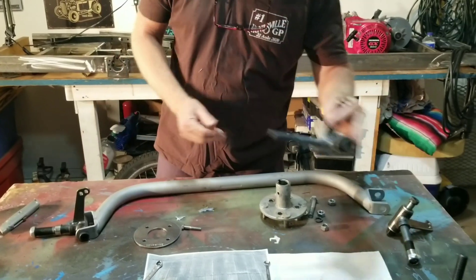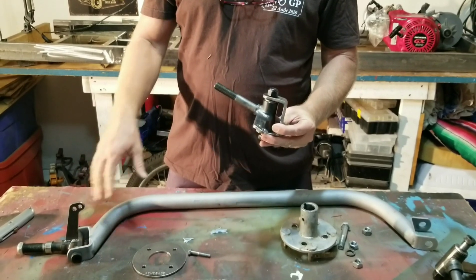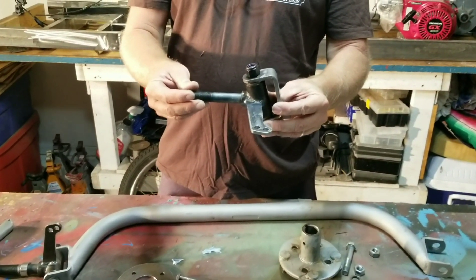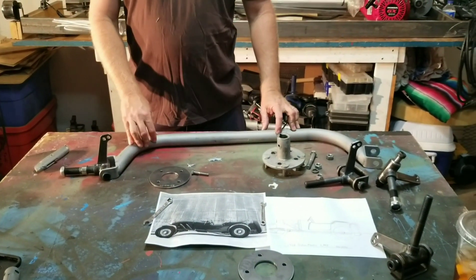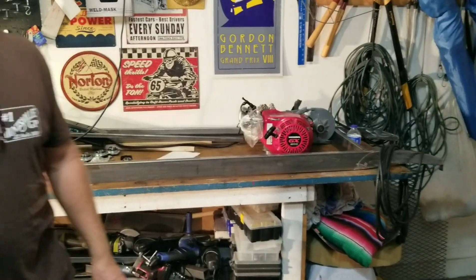That's it for the unboxing video. Hope that was educational and helpful. If you want a cycle cart that handles well and is engineered right, this axle is a good investment - or at very least the spindles you add to your own axle. If you've already got a completed cycle cart and don't want to redo everything, you can cut off your existing ones and change the angle to weld this on and get proper kingpin inclination. It's really worth the effort. Thanks for watching - we'll have more videos on the Aston Martin soon, and we'll have that on the road pretty soon. Have a great day!